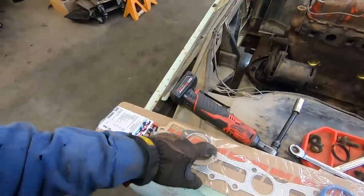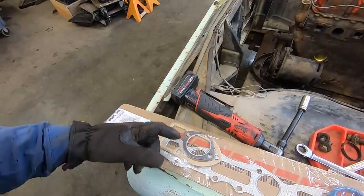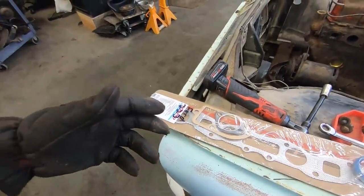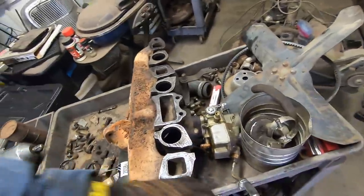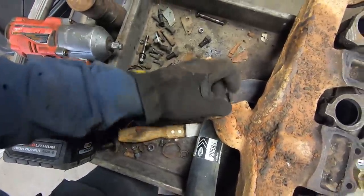We're not taking that apart because from my experience, those bolts just break off and they really don't ever seem to leak in there. I mean, I haven't had any that do that. So yeah, and it's just a heat riser. Anyway, I don't think exhaust actually, maybe it does. Yeah, I don't think this is cut for a donut. So we're just using that flange gasket. Obviously you wouldn't have both. Maybe it's not obvious to everybody, but you don't.